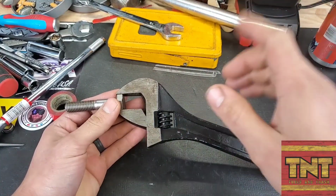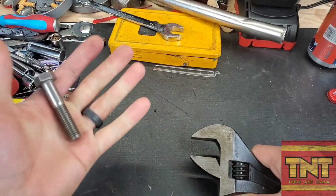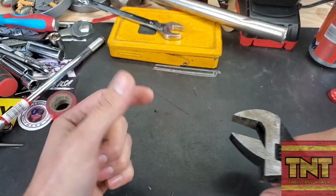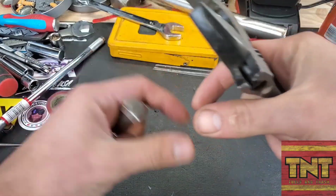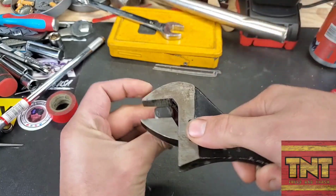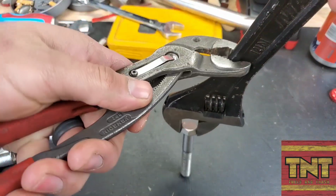So, first one wasn't much of a cheat. This one is. This one, you can call it lots of different things depending on where you're from. I've heard guys at work call it a Mexican socket set. Don't take that a bad way. I'm also Mexican, so I can make those jokes. So, all right, check this out. Grab your crescent wrench. You've got a bolt. This is normally for bigger, large fasteners down in recessed holes, or pipe fittings, actually. Like Swagelok fittings that have square ends on the 90s, yada yada yada. So you get this down that deep, dirty, dark hole that you'd love to stick your hands in. Get your crescent wrench down there, and let's say you can't get it on like that, right? So you stick your crescent wrench down in there, stick it on there like that. And typically I would use a pipe wrench. This is just an example.